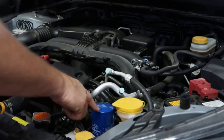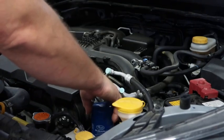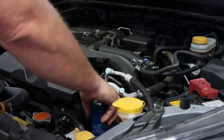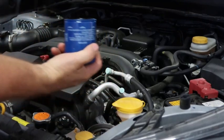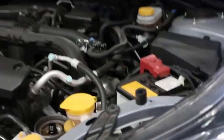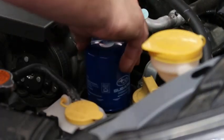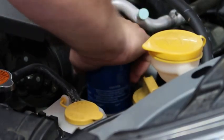I always take my oil filter off real slow, let the oil drain out into the catch pan. I don't like to take it off too fast — you know, it may spill and you've got a little bit more cleanup. Take it off real slow. See how quick and easy that was to take off. It kind of looks like it don't make a mess — just take your time, take it off slow, and there's very little cleanup to do.